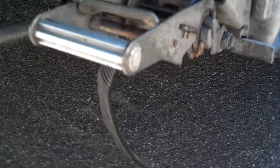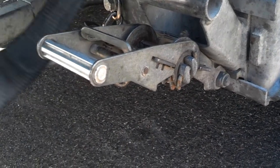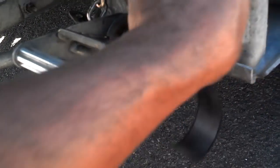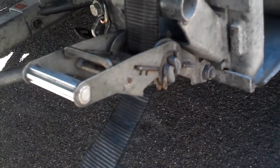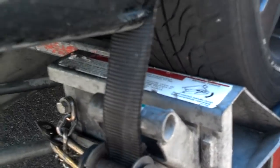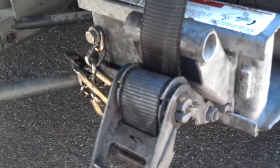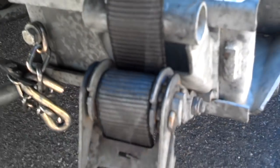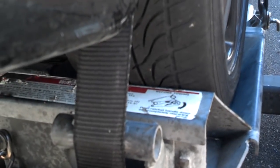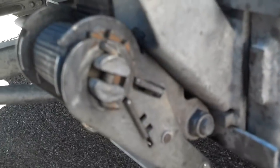I'll show you how to do this tie-down. You want it open, then thread the rope through the tie-down and bring the strap down. Not tight — just take the slack off. Now crank it and let it take the slack off because you want it to go around at least once to lock the strap in. Now that the strap is locked in, tighten it pretty much until you can't tighten it anymore. You'll hear the tire creaking. Once you hear that creaking, lock it all the way in.